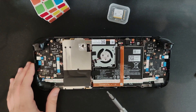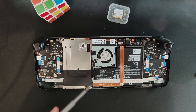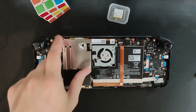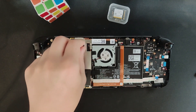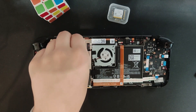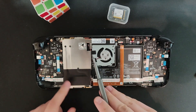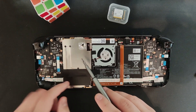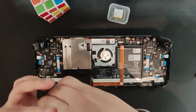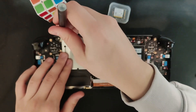While researching the OLED model, I found out that the Steam Deck actually had a tiny refresh where you don't have this aluminum plate but instead have a darker black one without the sticker. The sticker in my case is really messed up. You should try to peel it off nicely. I was surprised there was actually a slight revision model. If you have the white/silver one like mine, you need to remove these three screws. If you have the black one, it's a little bit different, but it shouldn't be too different.